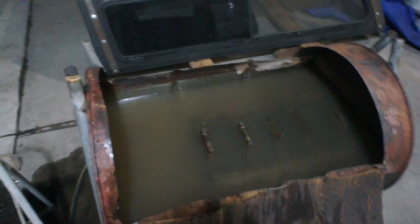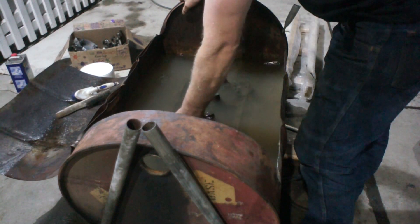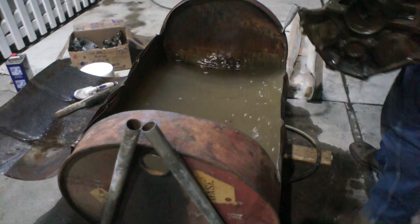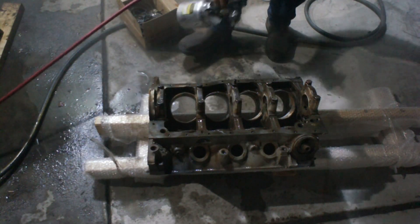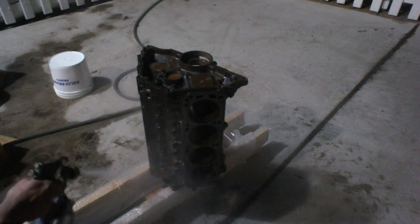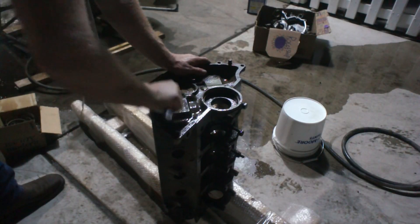1, 2, 3, 4, 5, 6, 7, 8, 9, 10. Alright, we ready for that? Let's get on it. So I'm going to pre-spray this — I haven't scrubbed it yet, but I'm kind of worried about the flash rust. This is a lot of surface area. I'm not really worried about the coolant passages, but I am pretty worried about the oil passages. So I'm going to shoot this whole thing down, then I'm going to scrub it, then hit it with some hot water, rinse it off, and then spray it the final time with WD-40.